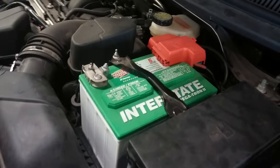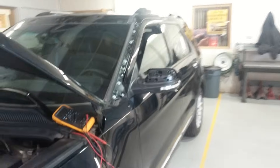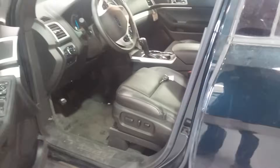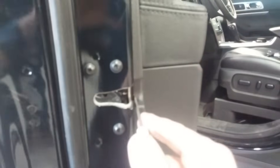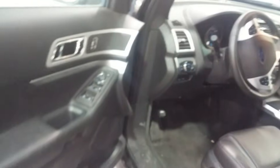To test this, we come to the battery and measure the amount of current flowing out. We'll start by making sure all the doors are closed. Sometimes it's helpful to get inside the car, so we can open the driver's door and trick the car into believing the door is closed. If there's a door jamb switch, we can trip that switch so it thinks it's closed. In this case, the switch is actually in the latch, so we trick the car into thinking the door is closed by flipping that latch over.